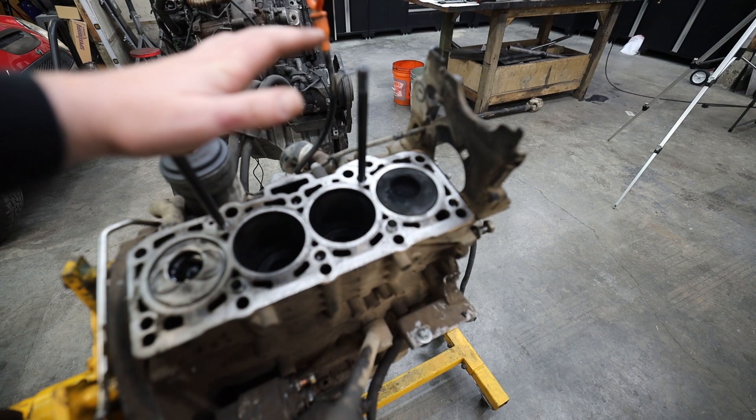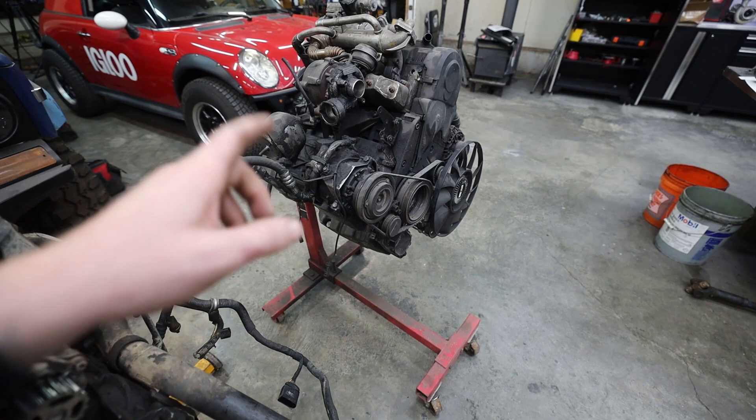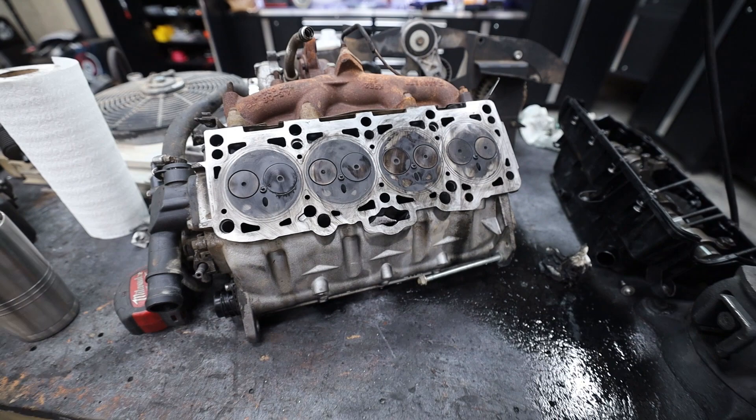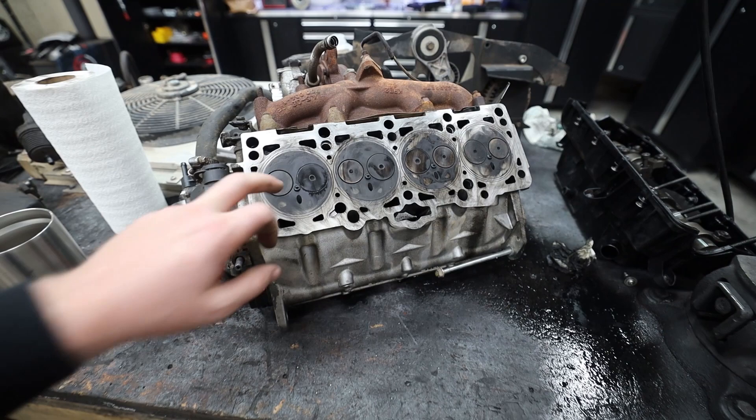So what I want to do today — because we're still waiting on some parts — is go over the full recipe. We have a ton of performance parts here in the shop and I'm going to go over everything, including turbos, that we're going to use to build the BHW. But first I want to tear apart this head, pull the injectors out very carefully, pull off the intake and exhaust manifolds, and pull these valves to see if this is still a good head. If it's just one bent valve, I can replace it. There's a lot of value in a perfectly good head — I could sell it and recoup some of my money from basically losing an engine. It'll also answer whether or not this valve clattered into the piston.